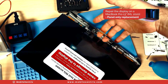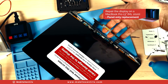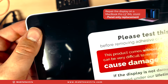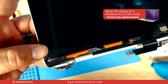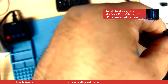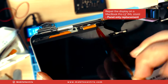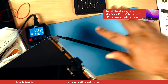I'm going to gently line up the bracket, making sure I'm not holding any of the flex cables so that everything goes in nicely. Then we'll line up the top corners nice and snug against the rubber, all the way down the sides. Make sure nothing gets trapped under the display. Now we've got the screws back in — we need to peel off the adhesive and apply some new adhesive. We'll leave this on the heat mat to warm up while we do that.